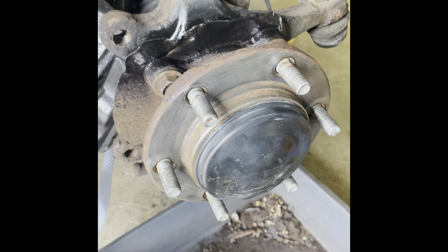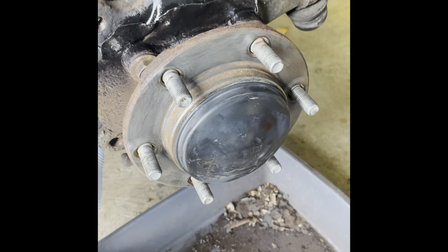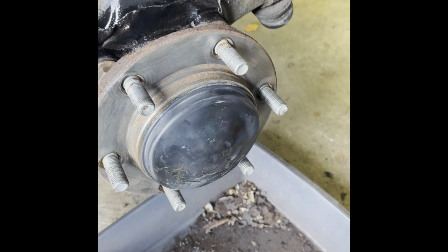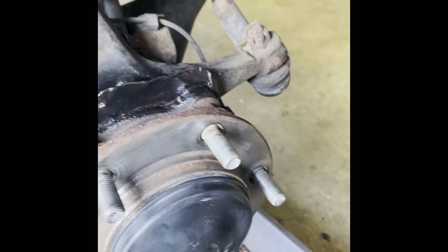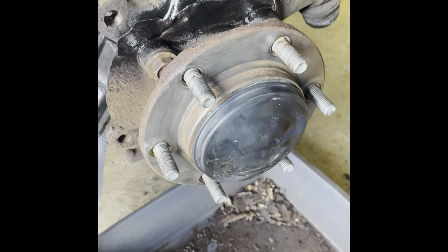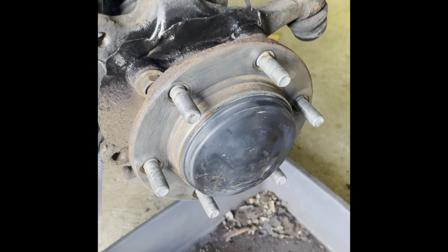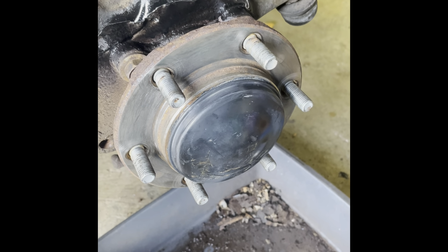Okay, so after trying to clean up that brake disc cover, it revealed how badly rotted it actually was. Quite surprising, really. This is only a five and a half year old truck, and as you can see there, look, all these fins inside are completely rotted away and snapping. The only part that was actually holding on is the top there and that little bit at the bottom. So I gave a mechanic mate of mine a ring and he said take it off, because that's possibly what was coming into contact with the discs on odd occasions, which is where we'd had the intermittent scraping sound. It wasn't really doing anything in that condition, to be honest, anyway.